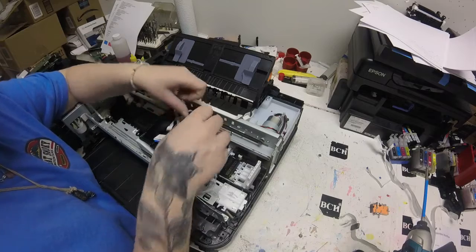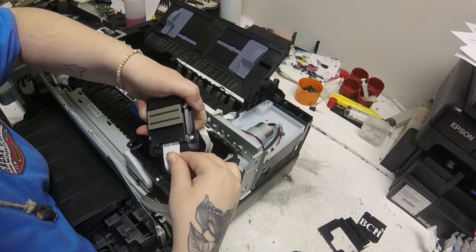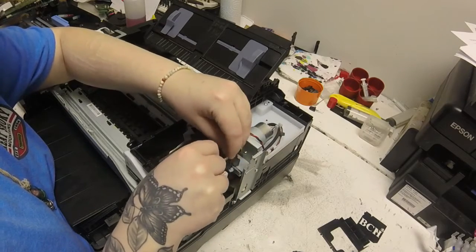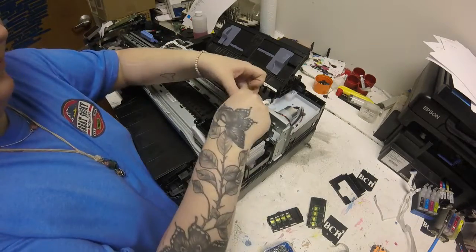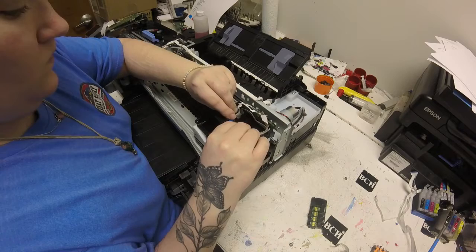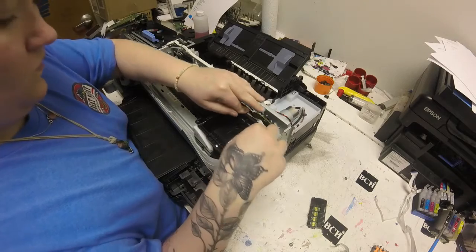Here I am working to try to get these cables to fit right. There's a little clip on the right side of that frame — you can fit the cables nicely into there and it'll help hold them. Here I'm putting the printhead back in. You flip it upside down and these either-side cables will fit in there nicely. Here I am trying to push those side cables back into that clip on that side. Here I'm just going to screw down — there'll be three screws that will help hold that printhead in place. Then there'll be another cover that sits on top of that. Then you're going to take this other FFC cable and put it into this other piece that will then fit down into that middle-ish piece that sits on the top of that printhead.